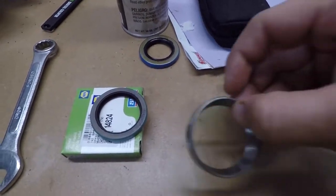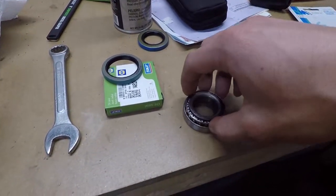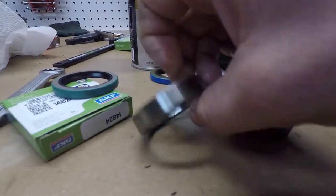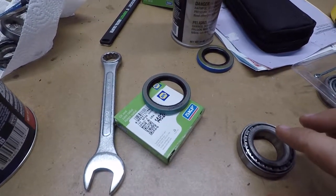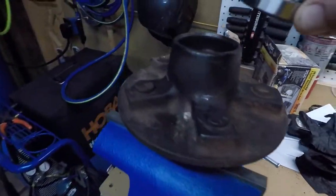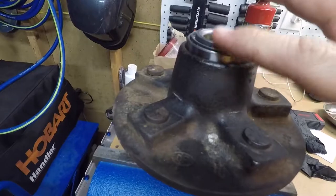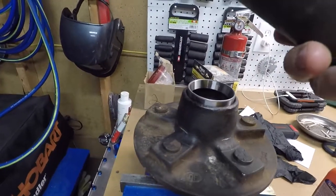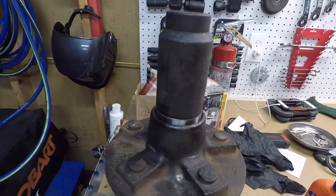Make sure these races are tapered — the bearing only fits in the race one way. If you flip it over, it obviously won't fit right. The wider edge always goes to the outside, so it's going to sit inside the hub like that. To press the race in straight, I happen to have a 36-millimeter socket — the kind used for axle nuts — and I can just hammer it on in. I have a press, so I'll use that since it's just as easy.